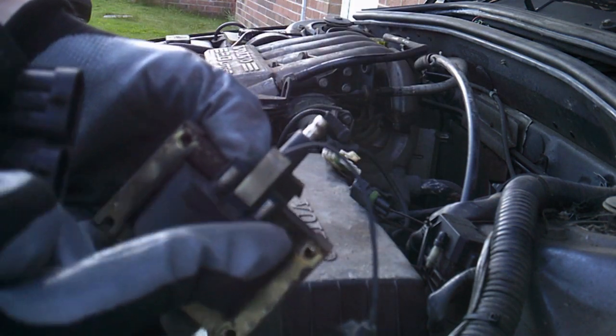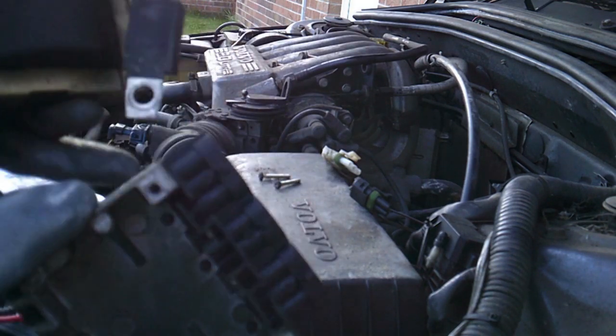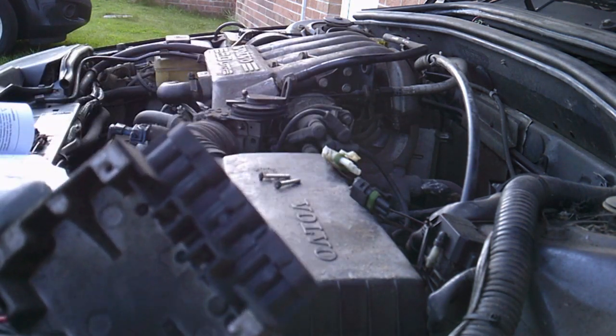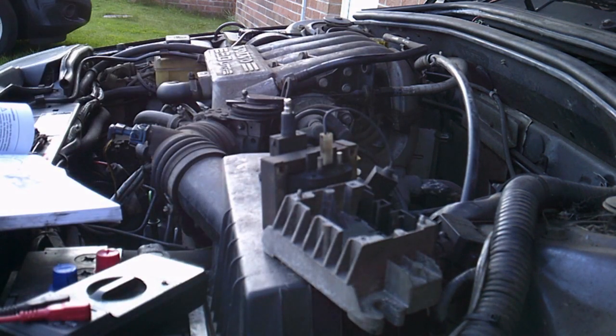You can see how it fits together - there's the coil on the top with the two pins that sit down into these two connectors. So this is what they're classing as the computer module ignition coil, and that's the coil itself. We can now test them independently and check the resistance.